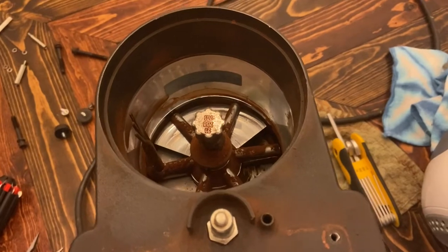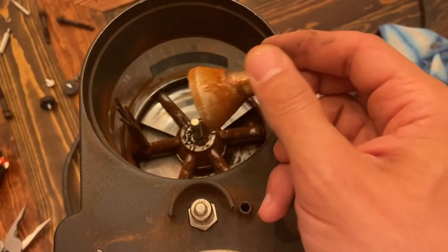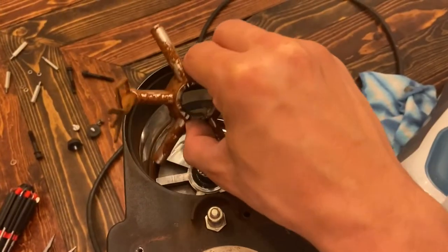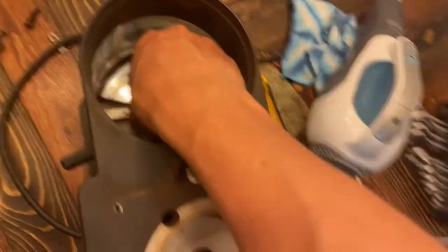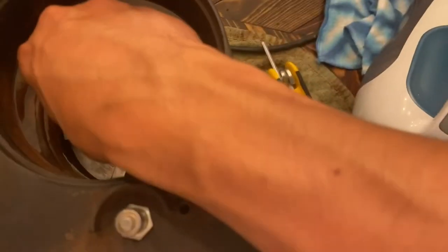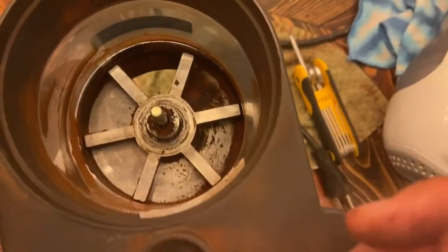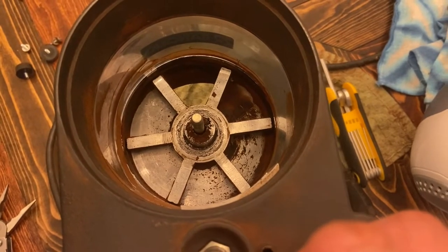While the other burrs are soaking, I tried to loosen this guy up and successfully did. I used some pliers and held the lever right here stationary so this part could come off — it just unscrewed, no big deal. So I'm hoping this piece comes with it — and it does, which is nice. Next comes this piece which has a key. That part comes off next, and then hopefully... that part doesn't come out, of course it doesn't. But I think I can just get in there with a scraper and clean it out, then use a wet hot rag to finish it up.